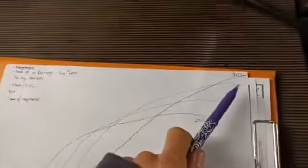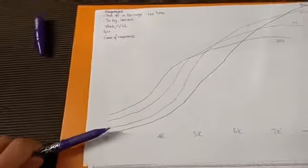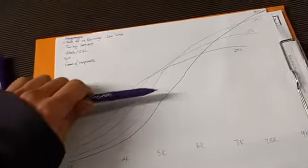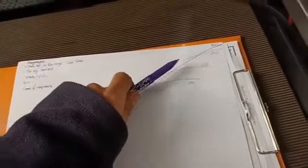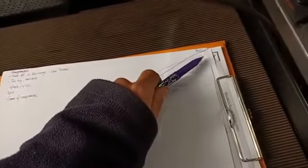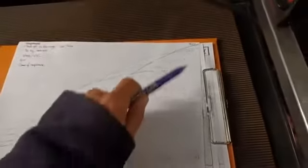So, illustrating more, let's go to this green camshaft, which I've called, say, 290 for argument's sake. Again, it's not an exact thing, it's just an illustration. So look, compared to the other two, we've given away even more bottom end. We're really not making much power until a lot higher RPM, say 5,000. This is where we're crossing over. After that we're gaining more, and again we're likely to make more peak power, but our peak power point has also shifted. So instead of it being, say, 7,500, we're now somewhere near 8,500, 9,000 RPM.